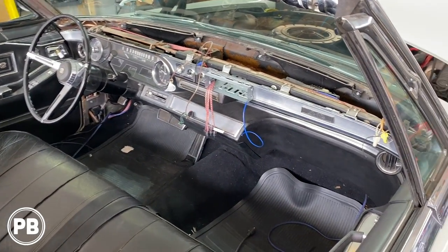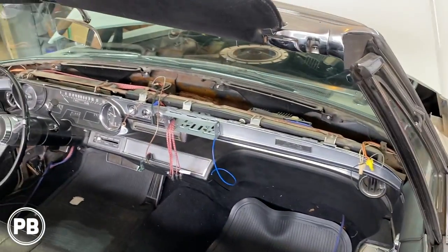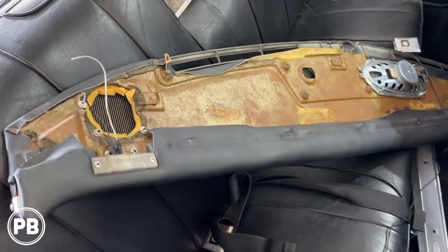On our next video, what we're going to be showing you is the radio install, the kick pods, and we're going to finish wiring up the rear speakers. We're going to do 6.5s down in the kick pods, and then we'll do some tweeters in the factory location up there on the top of the dash pad. They'll actually mount up underneath to these bolts, which will be super nice.